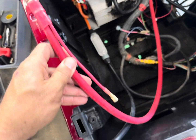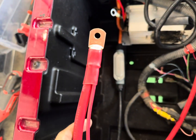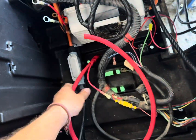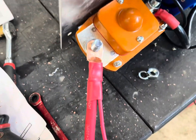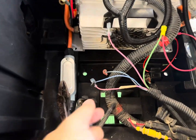We took some two-gauge cable and put a connector on it — I'll bore that out so it fits on the solenoid — and then this goes to the original wire right here, and this will go to the controller and to the battery. This is the lead we made: I got a 5/16-inch end on this side that connects to the battery terminal, and then the 3/8-inch bored end goes on the solenoid, connecting to where the existing one was.